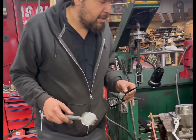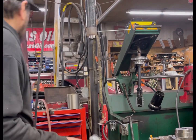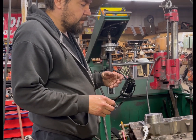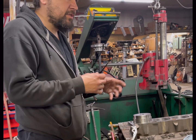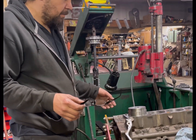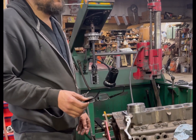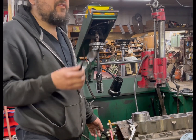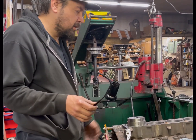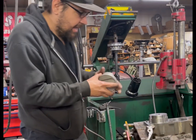Race engines always put so much clearance in them — like that piston's got seven-thousandths clearance in it. Is it mostly just important to have them the same rather than a specific size? I would think it's more important to have... Generally, the damage you do is because the cylinder is too tight. When I first started doing this, I was surprised — I'd get a block back from a machine shop and measure my piston and have like eight-thousandths clearance. They're sort of covering their ass: if it goes out there a little loose it won't blow up, but too tight and it will.